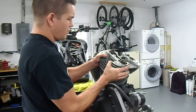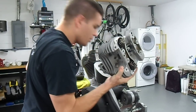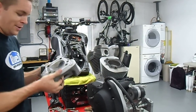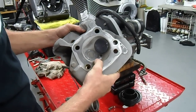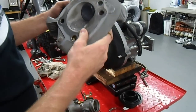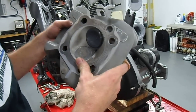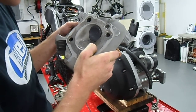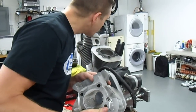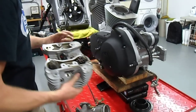I hope that there's not a whole bunch of damage. Definitely got some piston damage. Got some aluminum deposited on the top of the cylinder. Actually no damage to the combustion chamber, it looks like. And it doesn't look like the valve hit the piston at all — which that's a nice find.